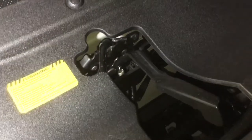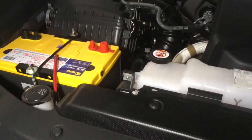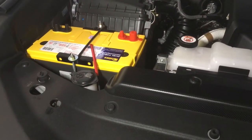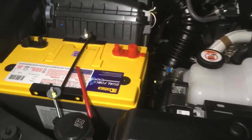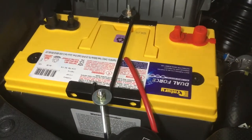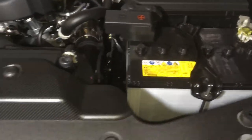This plastic cover has got to come off soon to run our wires. We're waiting for a new bracket coming from Kaon that also holds an SBI 12, because we're running an SBI 12 on this one - that's the plan. We're going to see how it goes and report back, because everybody tells you that you need a DC-DC. Well, we're going to run it without one and see what happens - how well the alternator can charge two batteries instead of one. If need be, it'll be a bracket where you can add the DC-DC, so you can have either or both. When this cover's off, we'll run the wire across under here to the main battery for the compressor, and with the SBI cables we could connect it to this one, but we'll send it over there to keep it neat and tidy.